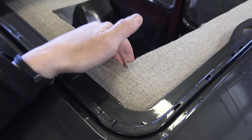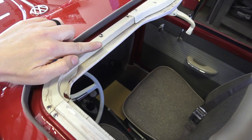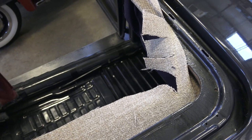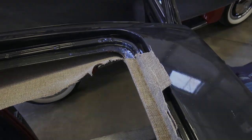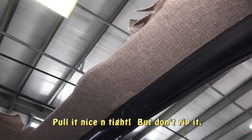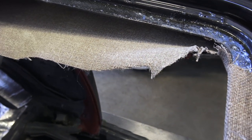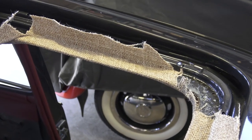You're going to cut a section — leave a good amount of material because you need that to glue onto those sills. Here's an original opening from a '65 sunroof: you've got the rails and the plastic pieces that cover that headliner material, so you do have some coverage there. If you did make a slight mistake, this material would help you hide that. Start slitting small cuts and just like a window opening, slowly start pushing the material, gluing on the sill and on the material itself. I started with the front — nice and neat. Go in and out to check how it looks. Remember: small cuts, use scissors or a razor, give yourself enough material. I glue the flat area and then also glue the headliner — you want to make sure they get tacky; it's basically a dry-on-dry situation and that's how it bonds. Pull it up nice and tight.